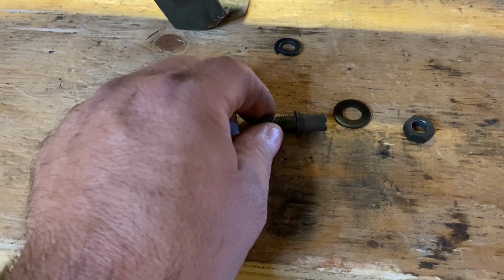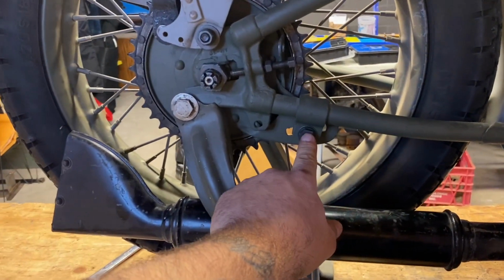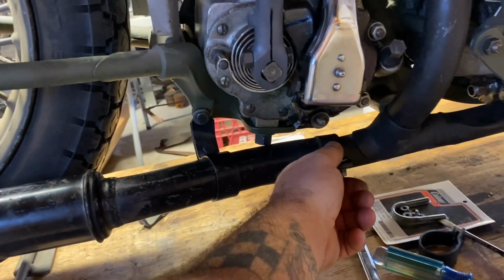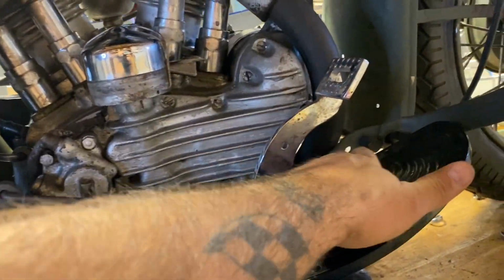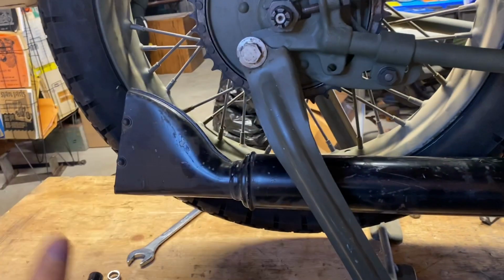So here's a specific bolt that goes into the rear brake anchor. So you can see right here how it allows it to go back and forth. That's for chain adjustment. So the whole mechanism can just go back and forth. So we got the brake anchor installed. We got the muffler mount bolted onto the back, behind the transmission. Another mount here. The rear head pipes on, the front head pipes on. We're missing a mount here, and we're missing a mount that would go from here around here and loop it. Just don't have that. That's a correct slanted 42, I believe, muffler.